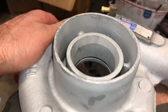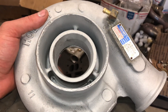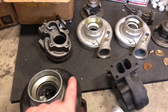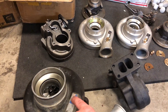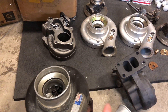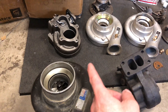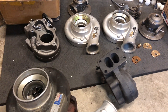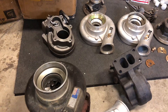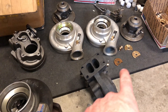This is a different version of the Holset where it doesn't have the machined inlet — some of them are machined, but both versions still have the same quality casting. Most of the time I spend more money on used genuine Holsets that need rebuilding than buying a new copy, and I continue to do that. I just think these are much better quality. I don't know if people would really want to buy that from me either, because what I do is take turbos and machine and upgrade them, and if I was to sell that kind of quality it's just bad for business — I'd rather have something genuine that people can trust.